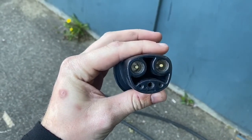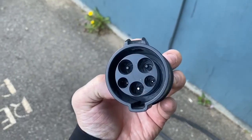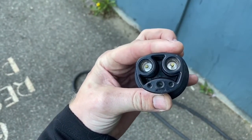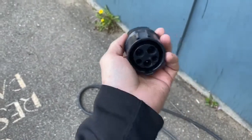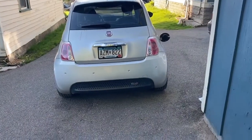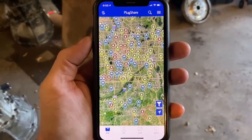This connector is becoming very common as well because it is used on Tesla vehicles. This is unique to the Tesla, however it adapts into J1772. Here you see the L1 and L2 220 volt pins at the top, you see the ground in the middle at the bottom, and of course the two communication leads. This connector is electrically compatible with the J1772 — L1, L2, ground, and then the two communication pins — so you can snap this onto a J1772 and charge your Tesla with level one or level two through a standard charger. However, you can't go the other way around, so if you have something like one of these fun little Fiat 500es you can't plug a Tesla charger into the port.